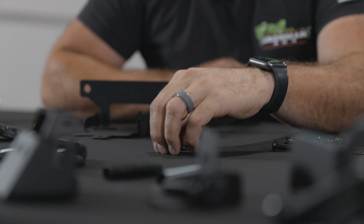And then let me show you how you build one of these little parking sensor assembly packs. So take one of these little gray squishy watermelon things and one of these gray caps. What you're gonna do is peel off the adhesive on the back side, and there's a little locating pin there. You push that through, you push this down, you pull the pin, and you're done. I'm gonna run this back through here. We're gonna take our parking sensor, clip it in, push it down, and then this cap fits right over those two little arms.